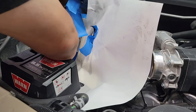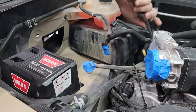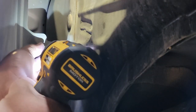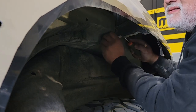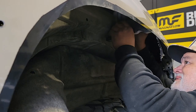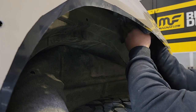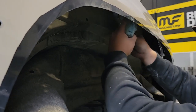That's the last of the painting and cutting. Clean up the areas around, cap off any critical areas where you don't want dust or metal particles, and blow it off — all of this area will be covered up very shortly. Now we need to work on getting the snorkel into the inner fender. To do that, release the inner fender from the outer fender — this bolt releases the tube. There's also a plastic insert in the way of the snorkel path. It's in fairly firmly; there are two pins that pass through the inner fender, and the outside edge is glued to the inside of the outer fender.